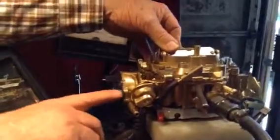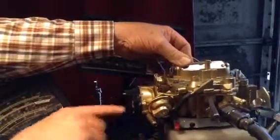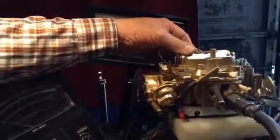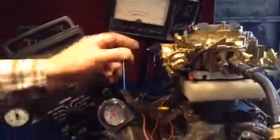We have an electric choke right here. When it gets cold weather, wherever you're at, you loosen up those three screws and you turn this whole thing until that choke touches like that. Then you tighten the three screws up and plug your hot wire in here. It's grounded internally — you don't need any grounding — and that choke will be like that. Then when you start the engine up, you turn the key on, electricity will go here and it starts unwinding that thermostatic control. Pretty soon it's straight up and down and away you go. Next time it gets cold, it'll automatically close. But it will not close the first time — you have to do it manually.